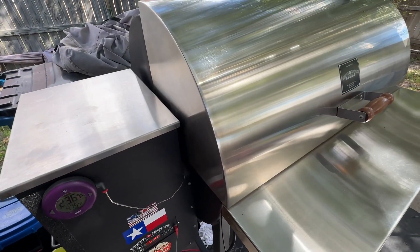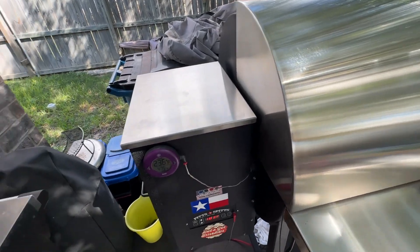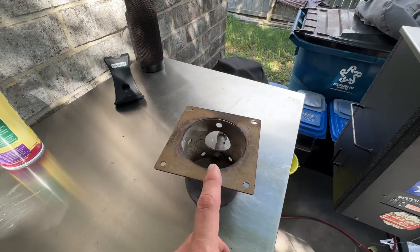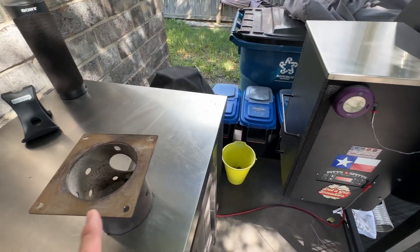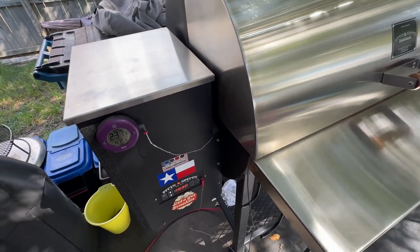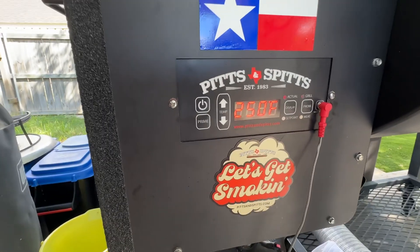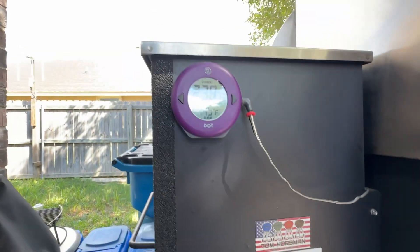Right now inside I have the original and I go back and forth, testing the seven-hole versus the nine-hole, just to confirm I'm not dreaming. And yes, it is better with the nine-hole. Thing is, if you have the U1.10 firmware and you do this, your temperatures are going to skyrocket — you may set it to 250 and end up at 275 inside the pit, because the controller lies pretty well.